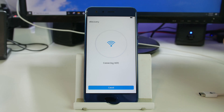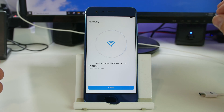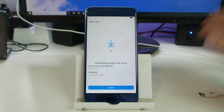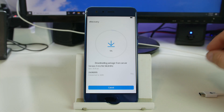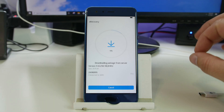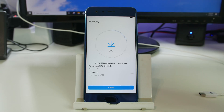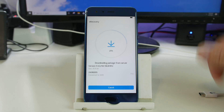The beauty of eRecovery is that it downloads the firmware for you. It goes out and pings Huawei's server and finds the latest firmware version for your device. You don't have to go online trying to find firmware or worry about the right version or model number. The full package is 3,576 megabytes — basically three and a half gigs — and it is downloading that firmware right now. It will do a full firmware restore and get you back to 100% stock firmware.